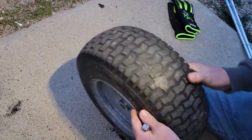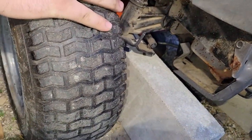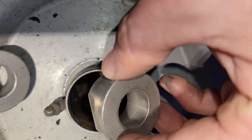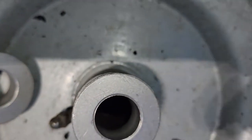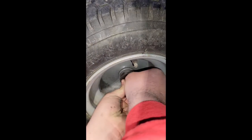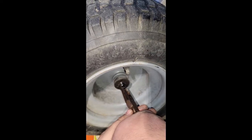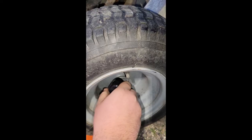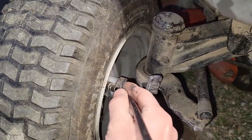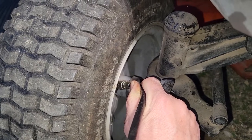That's it. We threw a little bit of grease on that shaft and now we'll put the wheel on. What you want to do is put that on the side of that grease zerk right there so you can kind of leave a gap so that grease can fit in there. Put the washer on and then your snap ring. Then the old plastic cap, which can sometimes be a bugger because it's super tight. Once you get the wheel on, you want to throw some grease on those zerks on the inside — about five or six pumps should be good.